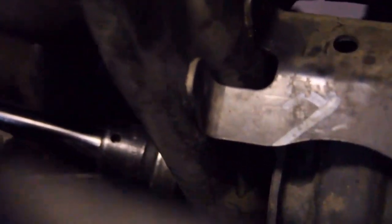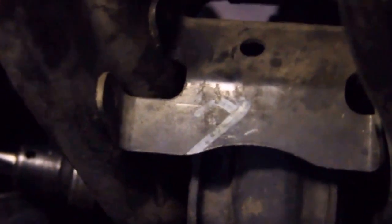The next bolt to take that bracket off is really impossible to properly film, but this is the best shot I can show you with the wrench on the bolt. It's a swivel 17mm socket, a short 3/8 extension, and a swivel head ratchet. It's kind of a combination of things to basically go around corners. So this takes a little bit of extra tools, but it's a tough area to work. And now I'll get that out. We'll move along to the motor mount itself after that.